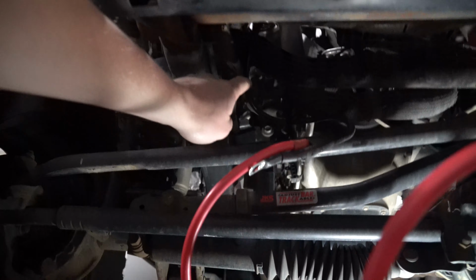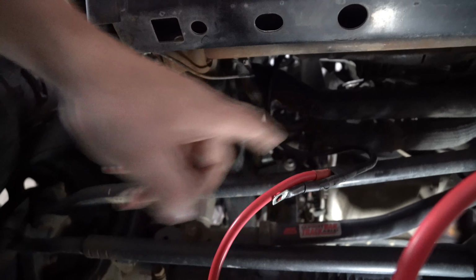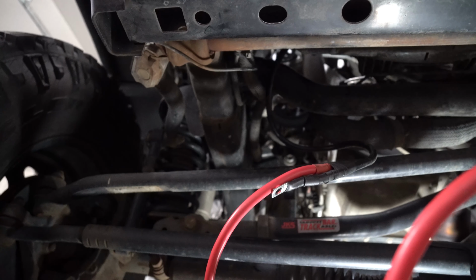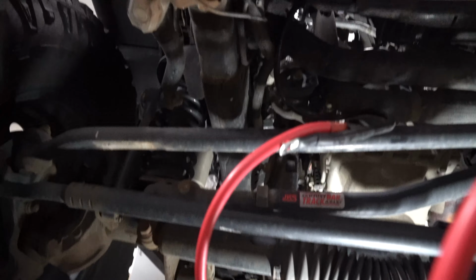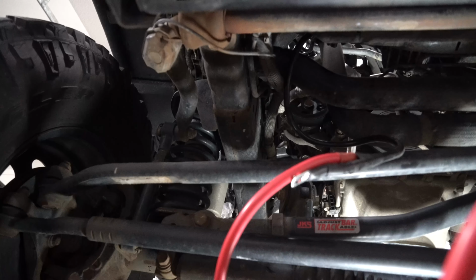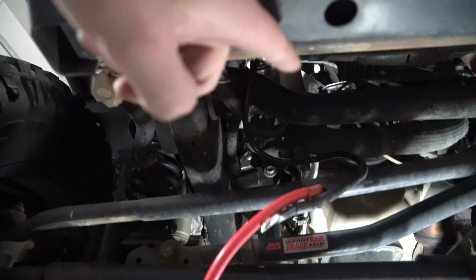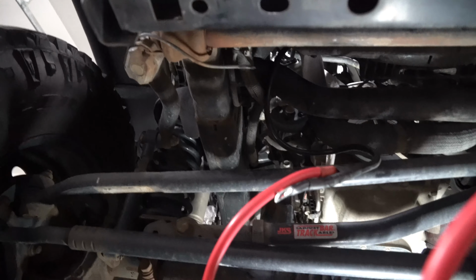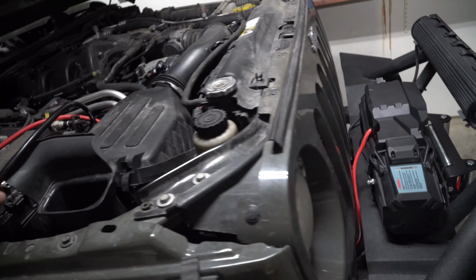If your winch is like mine and they've attached the power wire, I use the ground wire to feed it down from the top, because it's always easier to gravity feed something than to try and feed it up. If you don't have a long zap strap, this is the best way. Feed the other wire down, move it around the things you don't want it to be around, and once you say, okay, that looks good, tie this on, pull this wire up, and then you can just drop the black wire back down. Just went through, and now we've got both wires up here.